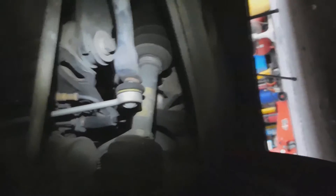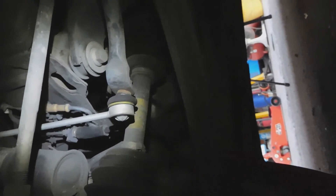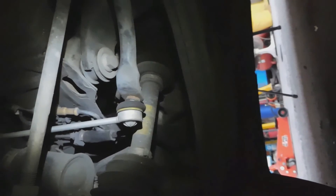You see there's a ball joint there that goes to the sway bar link, and there's another one up the top which goes to the actual strut. You can find that one or both of these have got slack in the ball joints and it will give you a clunk when the thing goes over. So be sure to check those — check both of those on both sides to make sure they're okay and your sway bar is not slack.